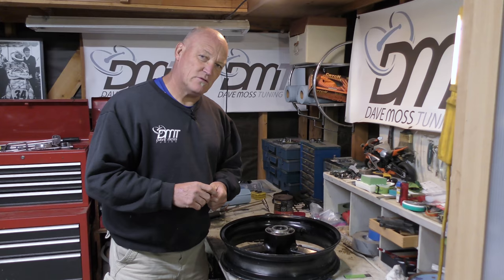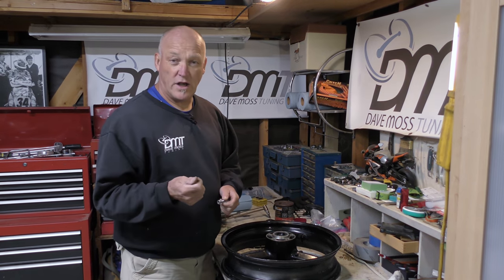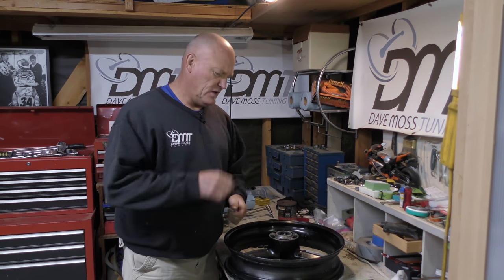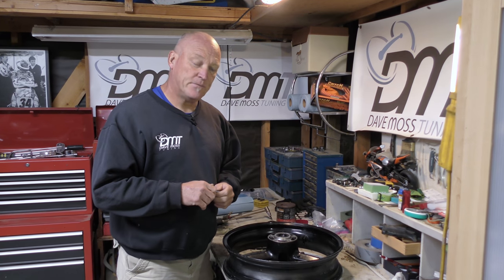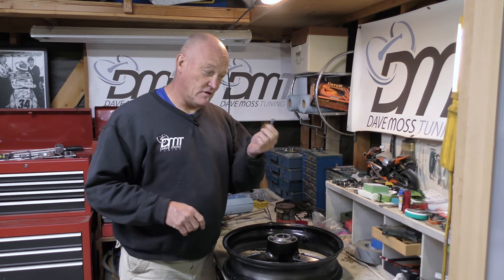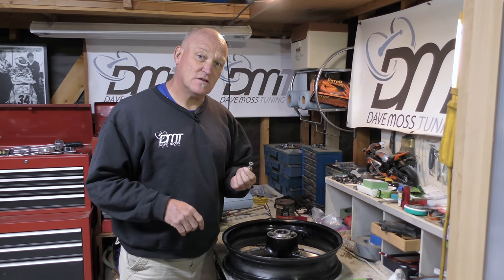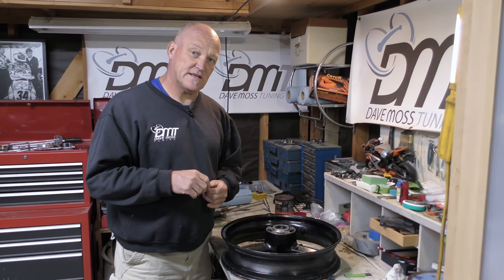Once you pull the bolts out, because there's Loctite in there, you have a couple of choices. One, use an old bolt that came out very easily and just run it up and down a few times and that'll break up that old Loctite. The other choice you have is to get a tap that is the correct, obviously, measurement for the thread pattern and run a tap in there which will guarantee that all the Loctite's out.